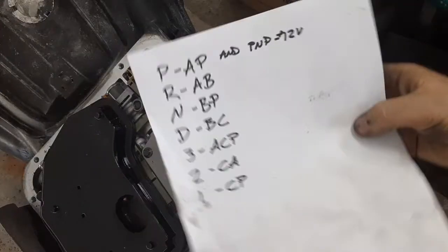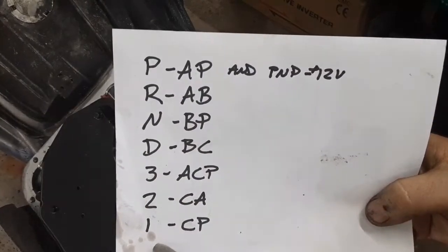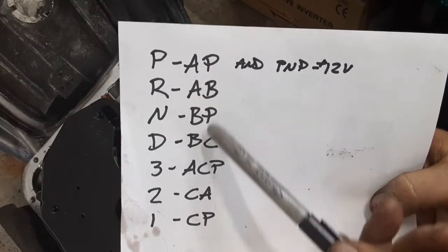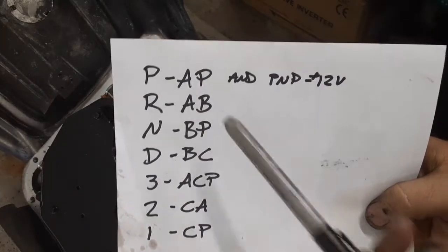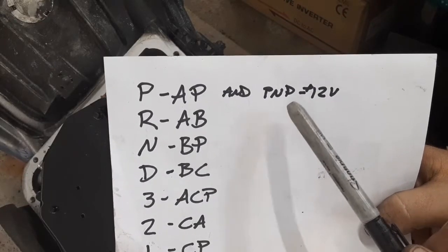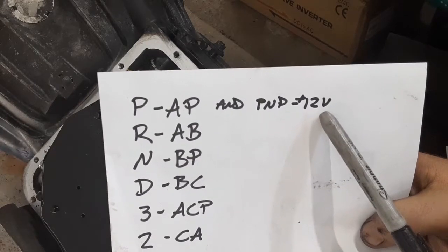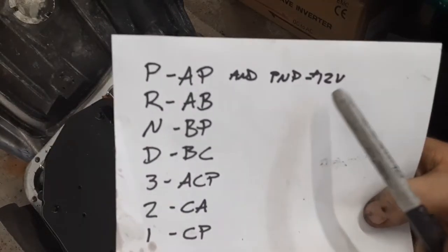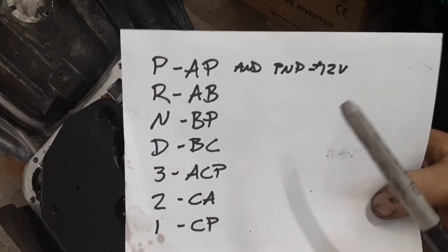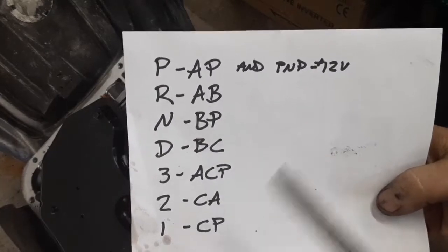I went through all my gear selectors and here's what I came up with. This shows gear selector position and which sets of wires the neutral connects to in each position. In park, the park neutral position switch wire connects to wire 11, which is a positive 12 volt. I'm not sure how that's going to work because on the other transmission there is no positive 12 going to the internal switch. So I'm about to go to the other transmission and do the same process to make sure they're the same.